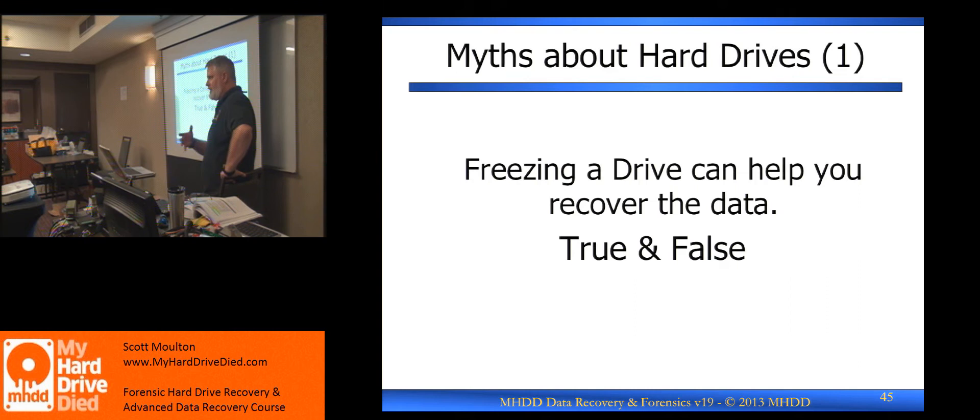When you hear any of those three sounds, you'll get used to recognizing them. Most of the time you can take the top of a hard drive off if you're in a pretty clean area. There will be a lot of arguments about clean areas — technically, many data recovery companies ran out of garages for years without clean rooms, and now they're saying every drive will never work if you open it, which is a lie. The majority of drives will be fine in a reasonably clean area because the air bearing surface will keep anything from sitting on top of the platters.